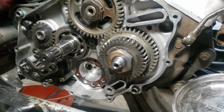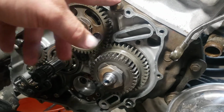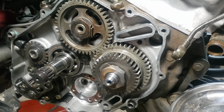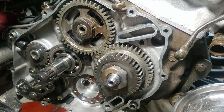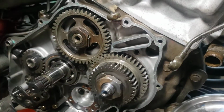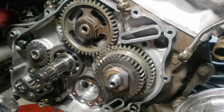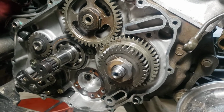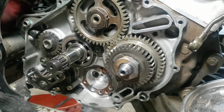I've run air and parts cleaner through all my orifices, so that's all clean, and I've got good flow everywhere. When I pulled the line off of there, I got good flow from the tank to the bottom of the motor. So I think the only reason that I wasn't getting circulation was because of the pump, which would be a fair assumption.